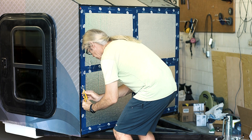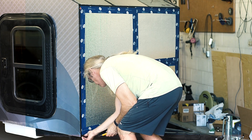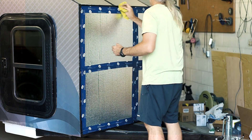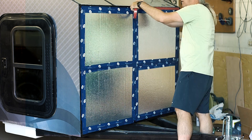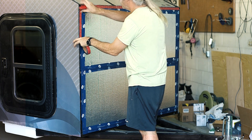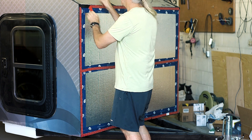I had used a tape called tuck tape — a really heavy-duty tape for taping in the insulation — and I really wanted to make an airtight barrier. I was concerned about the adhesion using VHB tape to stick the checker plate on to the front of the trailer, and I realized pretty rapidly that I was better to wipe the tuck tape with isopropyl alcohol and then apply the VHB. I used a lot of VHB on the front of the trailer. You want to make sure you're getting really good adhesion — this stuff is brutally expensive, it's $150 a roll.